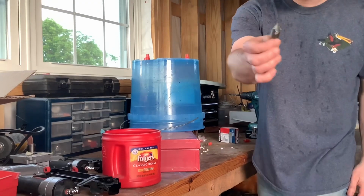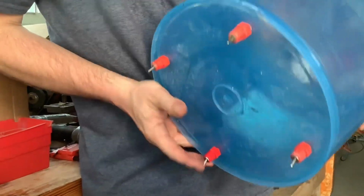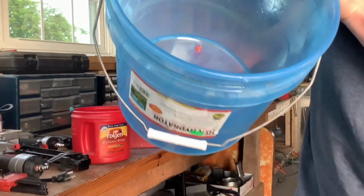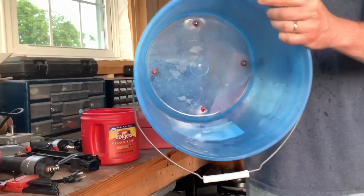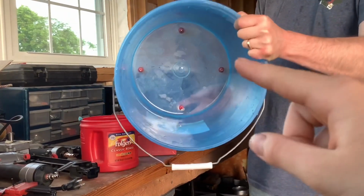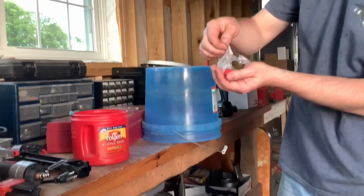We got a little deburring tool. We're just gonna take that by hand. I'm just gonna take that. If you can see, it should be the one on the bottom. That's got nice movement. For the other three, we'll just replace those as well. So I tap these here. So I'm tapping this. You can see the bottom one wiggle a little bit right there. The bottom one's moving, but this top one doesn't even move an inch. The top two, they're just full of junk, so we're just gonna replace them. Nipple 5-pack.